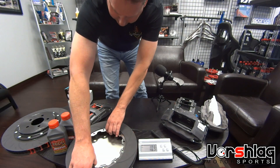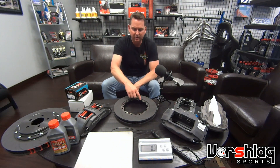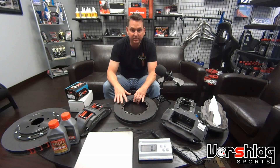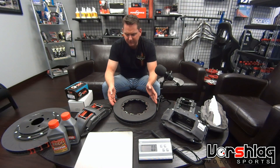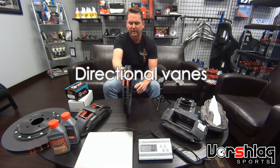It's 11 pounds — that's a big ol' monster. And you can just reuse the hats. Whenever they sell you the rotor rings, they include new hardware and bobbins, and they make these a few different ways for differing amounts of float. They usually keep these here in the U.S. These are cast in Italy — they're beautiful castings with really nice venting.